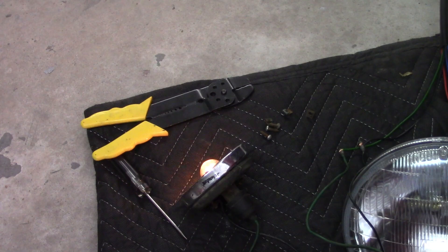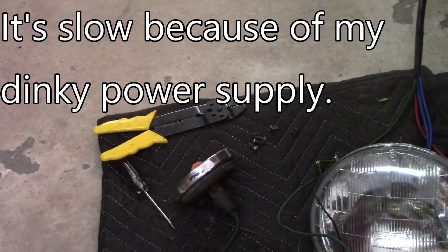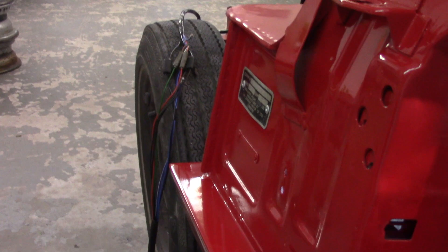Turning the lights off and hitting the blinker — there you go, it actually blinks. The little flasher unit is that small silver guy up there. You can just barely hear it clicking. When everything is loaded on the power supply the blinker kind of stops blinking — it needs a pretty good current draw on the flasher to work properly. I've got to figure out what's causing the ground on the blue with white tracer — it's grounded even when unplugged, which makes me a little nervous.